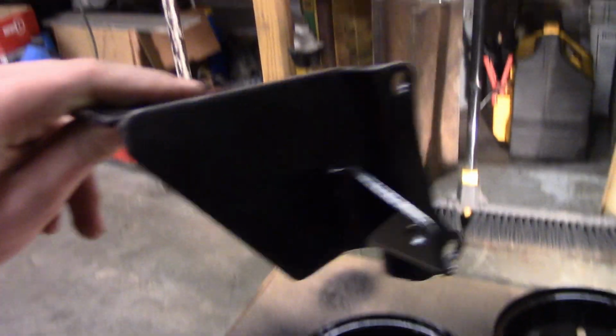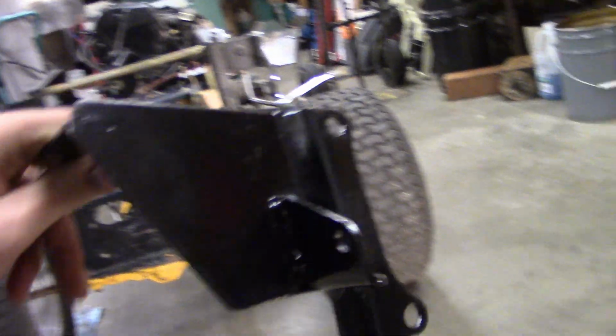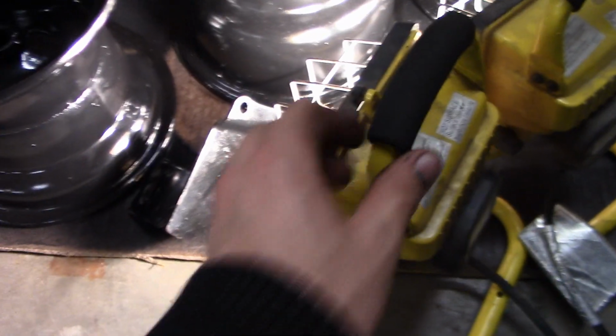So this piece is here drying. This is the engine mount. It bolts up like that, and this would kind of sit behind the front engine pulley. So all I did was just cut a little section out that used to kind of go like this, I think. There also used to be a nut on here somewhere, so I cut it out. There was a hole, and I welded it back in. It used to be pretty much about here. There used to be a nut. So yeah, it should be all good now. It fits the pulley nicely. So that's it dry.